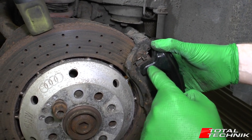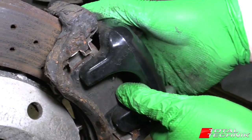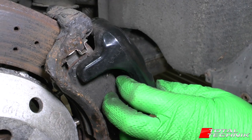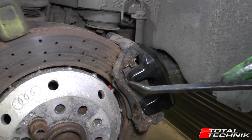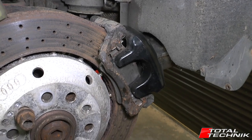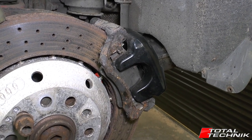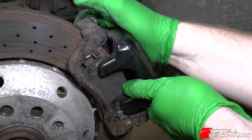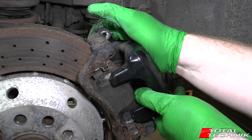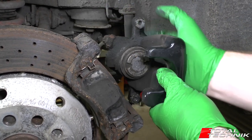All you're doing is sliding the face of the caliper over the face of the brake pad — the brake pad stays where it is. If yours isn't quite as easy, you can come in with a lever tool and start trying to find points to help lever it off. If it's on tight, that is really the only option. But hopefully they come off all right — and even with all the corrosion on the bolts, these are probably about as bad as you can get.